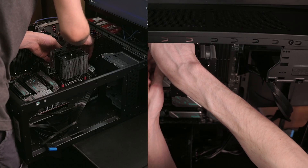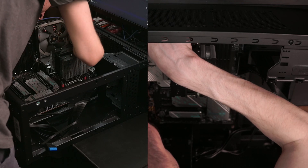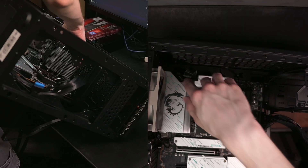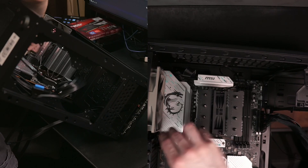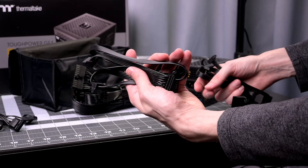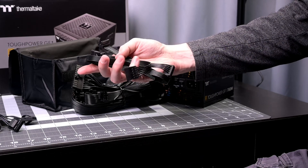In my case I'm using an RTX 4060, which doesn't need a ton of additional power. The CPU power connectors were difficult to orientate and attach to my specific motherboard, the MSI X670E Gaming Plus Wi-Fi, but it did work out okay. With the cables being thin, I was able to use that memory on the cables a bit with the fan on top of the case to get those two CPU connectors attached. But I would have liked some more length to this cable, or if they were separated into two CPU power connector cables that would be very nice. It's just one cable. Overall it is a somewhat limited selection of cables and they have a lot of daisy chaining going on — I would have preferred some of this stuff broken out into different cable types.